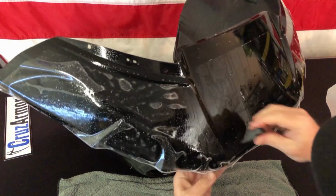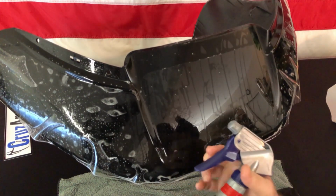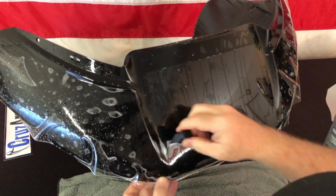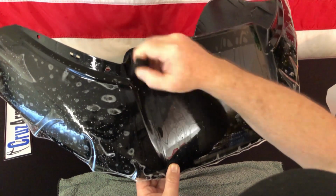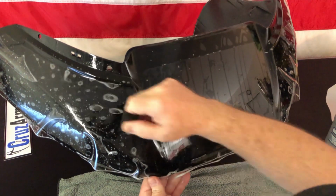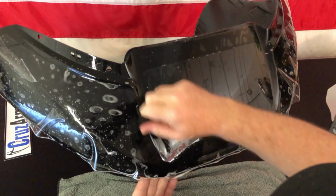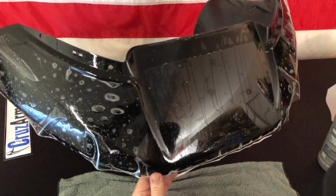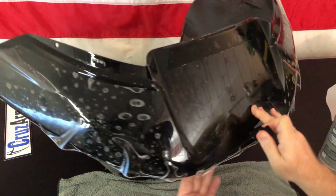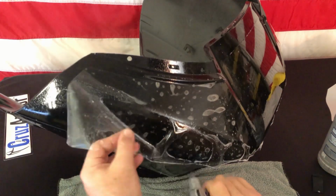You want to make sure, even in this area, it's not a bad idea to have the alcohol mixture just a little bit here and underneath here. And what that's gonna do is make sure that that locks down. Because when we pull on this tip out here, we don't want it lifting this up off the valley. We don't want the tension to pull that off the valley there. We want to make sure that that's laid down a good inch away from the valley there, okay? Now we're gonna come out here. If this is still slipping, if not, we can put a little more soap again.